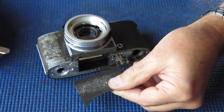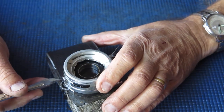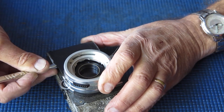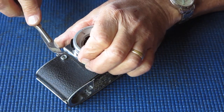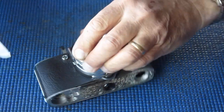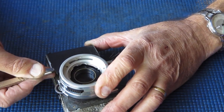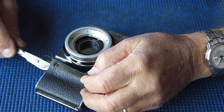Alright, that came off nicely. And its mate on this side. If you slip when you're getting the leatherettes off and poke your scalpel through, it's usually not the end of the world. Once leatherettes are all firmly glued back in position, cuts and tears tend to disappear largely, particularly fairly sharp cuts. And even where there's slightly more damage than that, you can fill the void with black wax crayon.